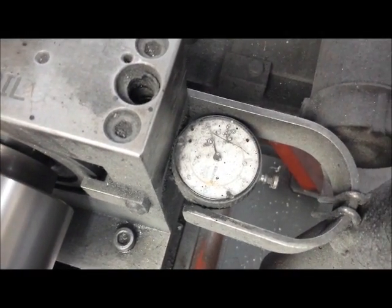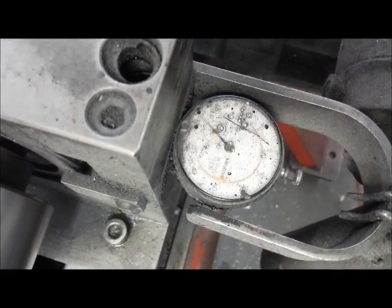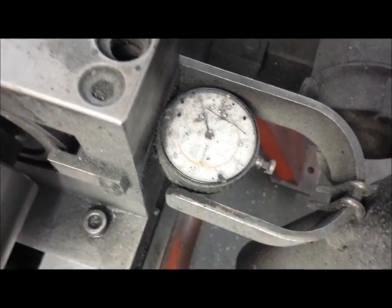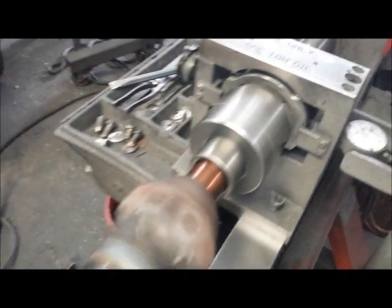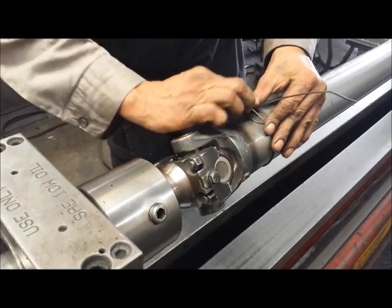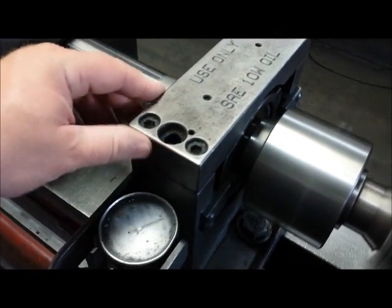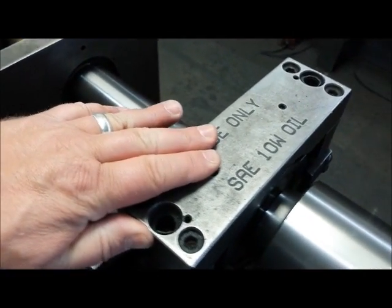The driveshaft is running in the balancer. Tomas says that when the vibration on the dial indicator stops moving around, he's gotten rid of the vibration — it's still bouncing a little but he's getting closer and closer to the right balance. I'm feeling this saddle right here and I can feel no vibration. So if I get it out on the road and feel some vibration, I'll know it's not in this driveshaft. Absolutely incredible.